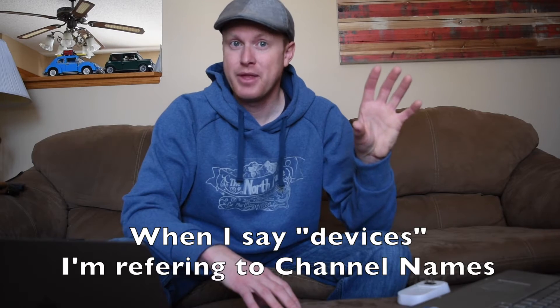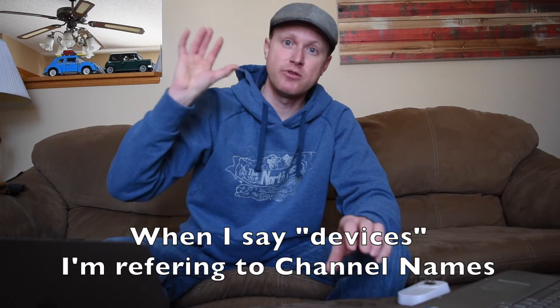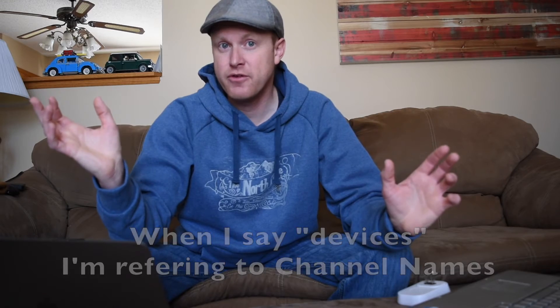There's a reason why we use three files instead of just one. When we ask Alexa to look for devices, she only looks for 20 seconds. 20 seconds is not enough time for the Raspberry Pi to go through 24 or more devices - she only has enough time to find 12. So we set these up in groups of 12: TiVo list 1 has 12 devices, TiVo list 2 has 12 devices. If you wanted a third file, you can put another 12 devices in a separate program.